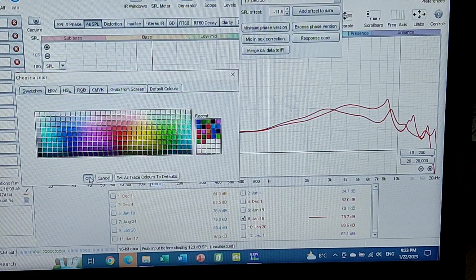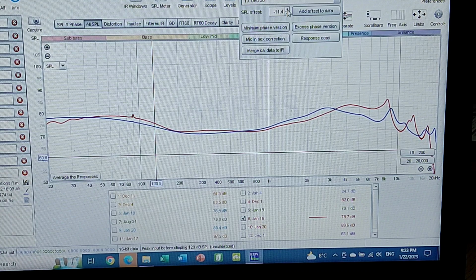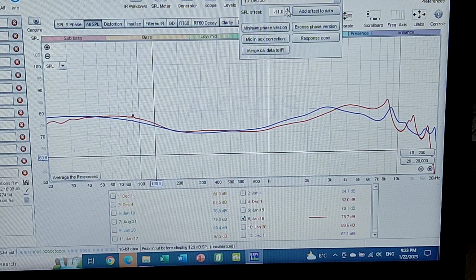There we go. As you can see, both of them have this tuning of the DIDI, which focuses on the sub bass, and by 200 hertz it's basically flat, either one of them. Actually, I'm going to center this at 500 hertz. Better. This will better explain what you actually hear. They both have the same kind of bass. Obviously, the bass of the variations is more polished, more quality. You can feel that the driver is obviously a better quality driver, so everything comes across with a little bit extra texture.